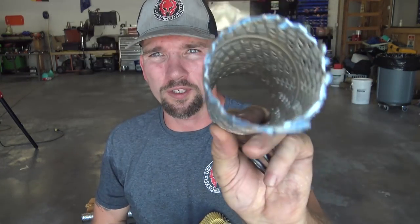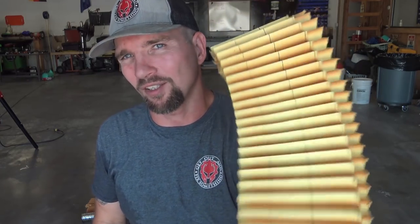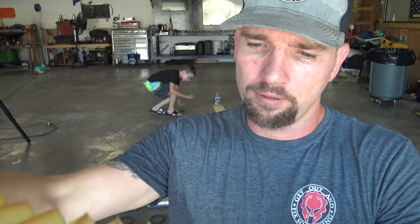You've got your top cap, your filter material that does the filtering, a little center section with a bunch of perforated holes to keep the filter material from going through. Then you have your actual filter media — that's what they call this stuff. Most manufacturers will just glue the ends together like Wix does. I've hardly ever found one of these glued joints broken apart on a Wix filter. That's how it comes apart — kind of accordions out. I'm going to stretch them out and show which one has more pleated filter material inside as far as lengths.